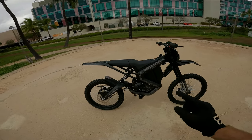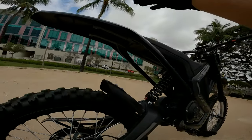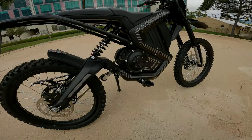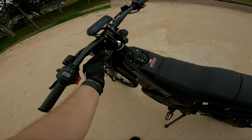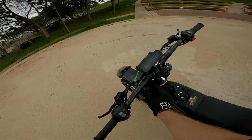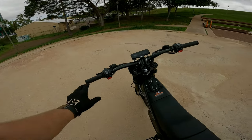Right to your rear wheel. The swing arm is way beefier. The design is aluminum, but the rear subframe now has these bars that come out, so you have reinforcement all the way past your rear seat. That's super cool. Discs on the brakes are 203 millimeters. I have the rear brake sensor disconnected — that's how I'm able to wheelie. You can just disconnect it and plug it right back in, no issues, no code comes up, works perfectly fine.